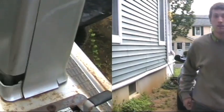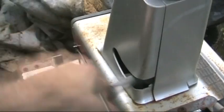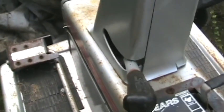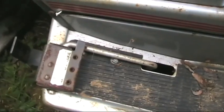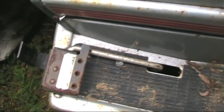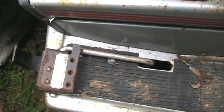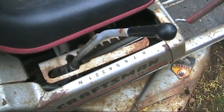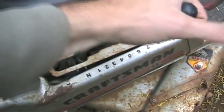The first thing you want to do is make sure none of your safety switches are tripped. Make sure the deck lever is off, or if it's an electric PTO, make sure the switch is off. You also want to check that your parking brake is fully pressed down — in this case it's locked, but sometimes that switch can go out of adjustment, so press down hard on the pedal. Some tractors also require the shifter to be in neutral in order to start.